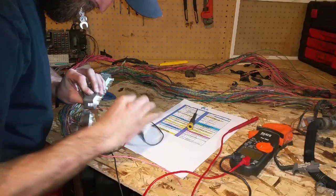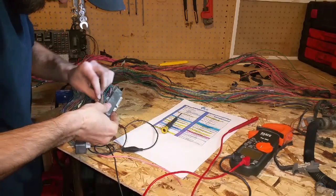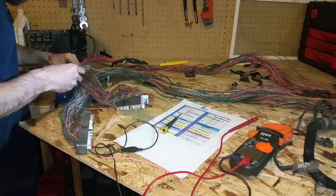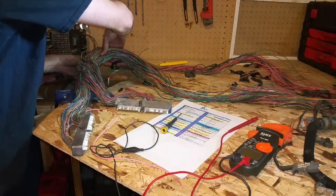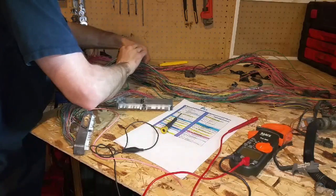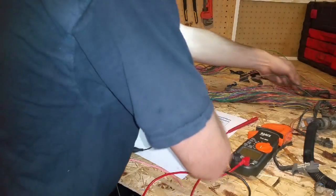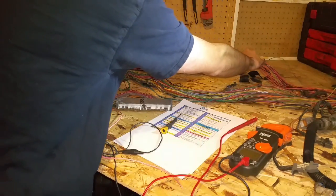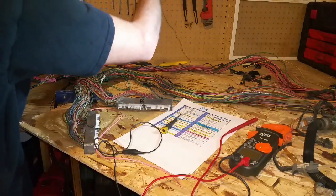This is the one I'm going to pull out. I'll push the pin through just like we showed before — basically I'm pushing the wire through and tracing it all the way through the harness. Be sure they don't catch or snag anything and tangle up the wires. Now I'm just going to trace the wire back through this way. Be sure that you keep the normal shape of the harness.